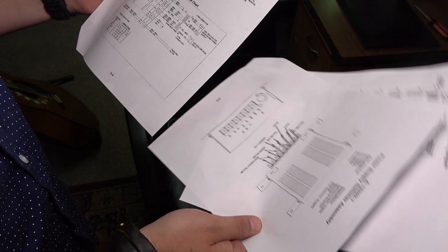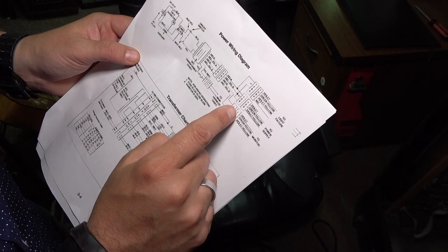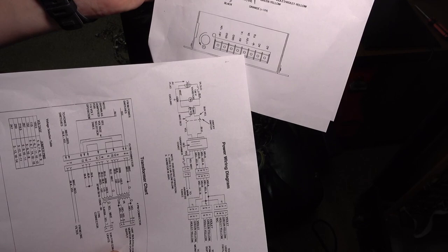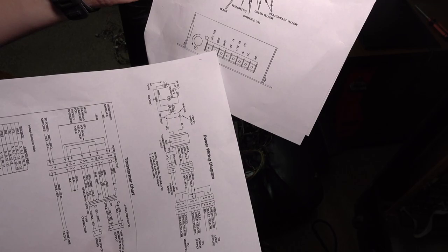Actually, here's power, okay? I'm looking for the power supply, which is violet and yellow, and green and yellow. Oh, green and yellow is the field ground here. If we look at the bottom, you can see it's AC, field ground or earth ground, or actually chassis ground, I guess. Plus 12 volts, minus 5. No, actually, that's earth ground, and this is the chassis ground right here. And then the logic ground, you guys correct me if I'm wrong. I'm sure you will. Minus 5 and plus 5.